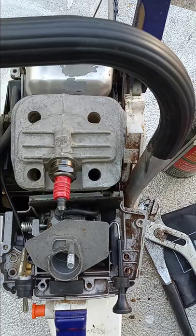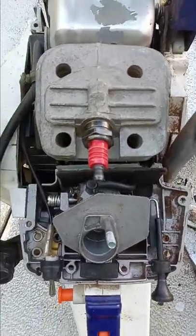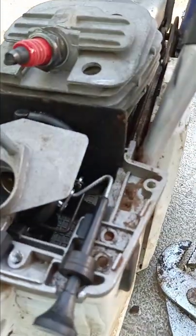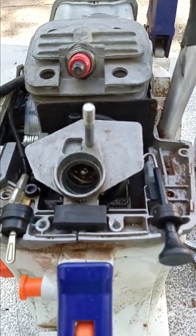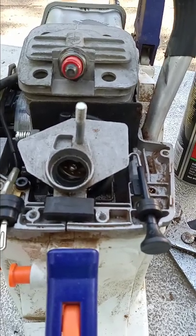By taking it loose I could see where the intake manifold meets the cylinder head. You could see where dust and fine particles had been drawn in around the gasket. I'm not sure if it was not tight enough — a lot of people say it's not tight enough to get to it. Others argue that it's some kind of defect and it's just not flat or it's cracked. I fixed this one by putting just a little bit of gasket seal over the top of that gasket.